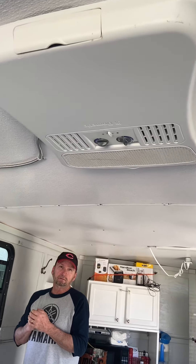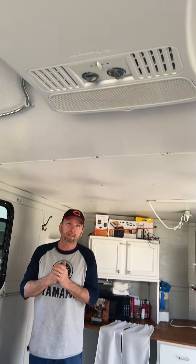I'm going to make a couple more videos. I've had a lot more views on my first video than I ever anticipated, and some requests for electrical videos — how did I wire it? And if you look straight up, we added air conditioning. Basically if you've got a roof vent, which pretty much all of this type of trailer does, you take out the roof vent and you've got the perfect size hole already for an air conditioner — those are made to fit that, I think it's a 14-inch by 14-inch hole. It's not terribly hard. Thanks for watching, watch out for more coming soon.